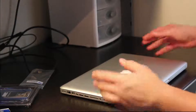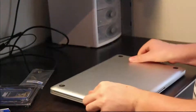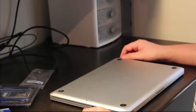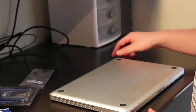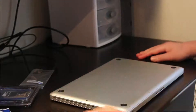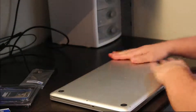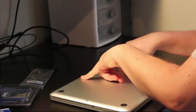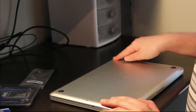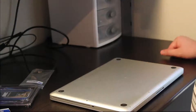Okay, so here we have the MacBook Pro. First step: turn it upside down. I should mention it's good to power it off — don't put it in sleep mode — and I've already done that. On the bottom you're going to see a series of screws all around the edge. You'll see three on one side, three on the other, and two in the middle. We're going to remove the three at the back first because they tend to be a little bit longer, then remove the rest and pop the cover off.